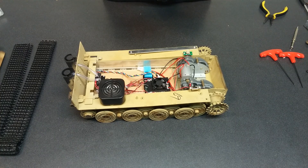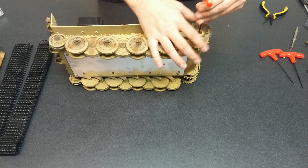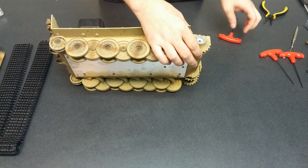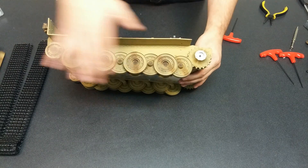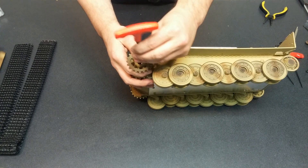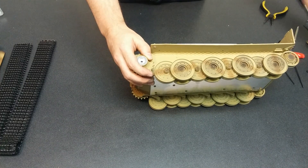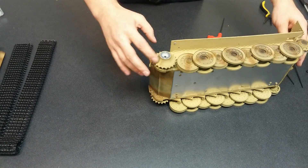You will need a three millimeter for taking off the drive wheels here. What I'm going to go ahead and do is just unscrew this guy here. Now, the top piece should come off fairly easy, just like that. If we're lucky, the bottom piece will come off fairly easy. This one's starting to come off, but I'm going to go ahead and leave it on there so I can show you guys the trick. This other side we're going to do the same. Once again, this is just a three millimeter. So that one came off fairly easy — this one's a little tighter than the other.